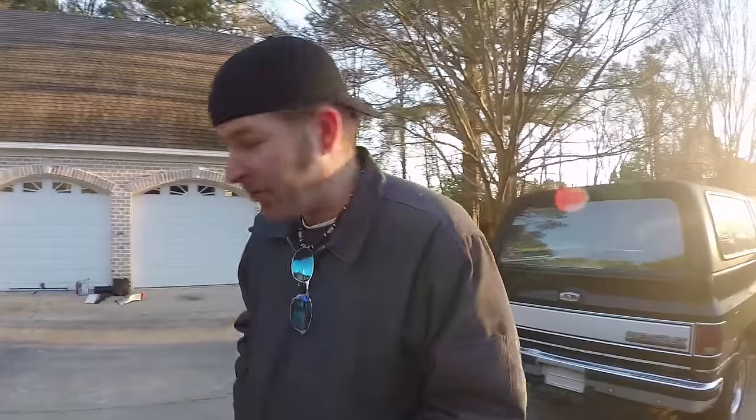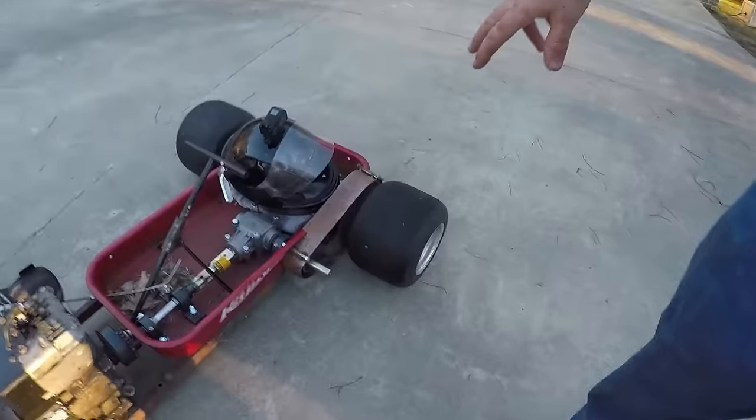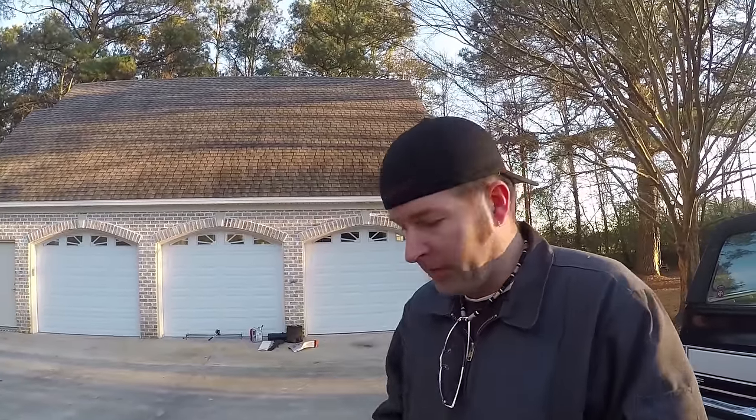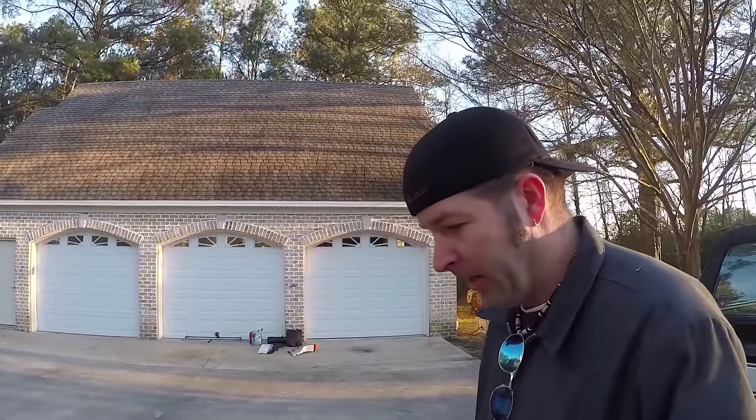Pretty good. There's a couple of things. I didn't line up the sprockets right. When you roll it backwards, it wants to throw a chain forwards. Okay. It's fine. And I looked, and we didn't get it just right. So, we didn't lube the chain. True. Chain's bunching up. So it needs to be lubed.